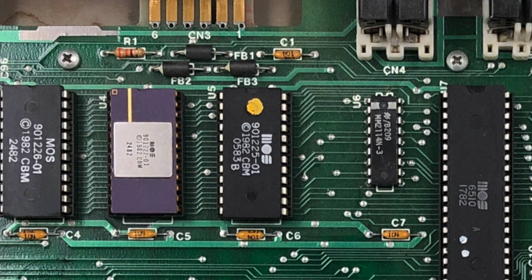The result was random slices of characters showing up on the screen. Worse was that because the VIC-2 thought the data was valid, the sparkle remnants on the screen would actually trigger sprite collisions. The sparkle bug affected the first few 100,000 Commodore 64s sold, and I've not found any reliable documentation on exactly how Commodore fixed the machines that were returned.